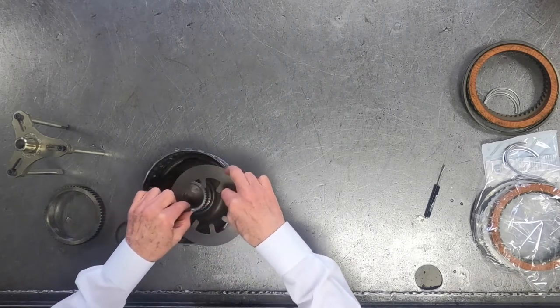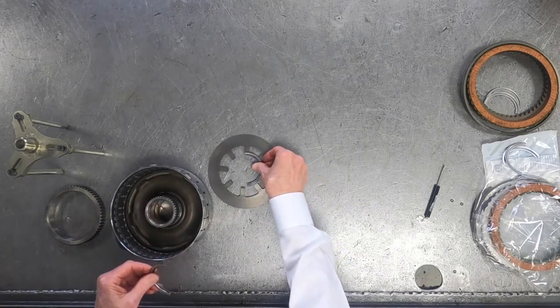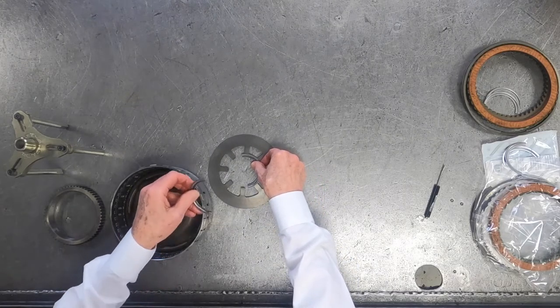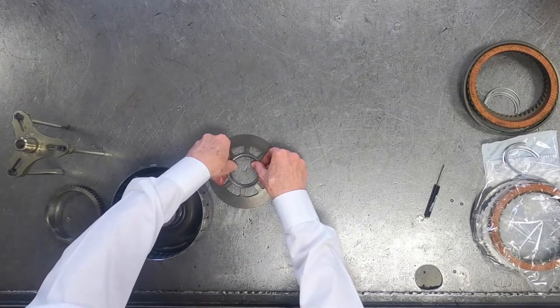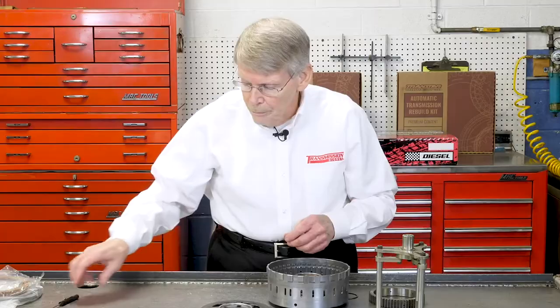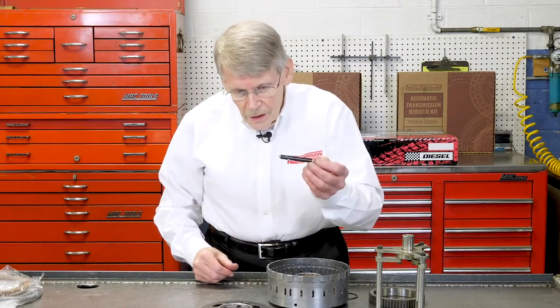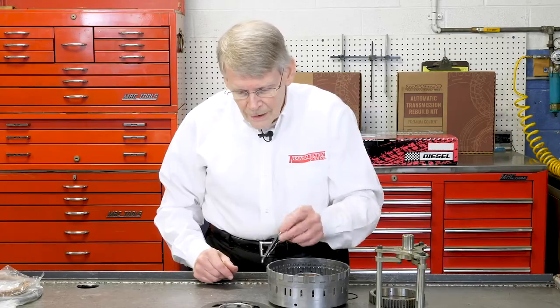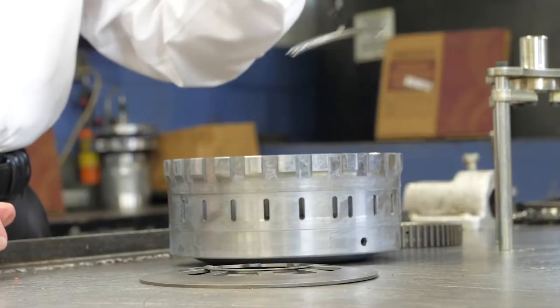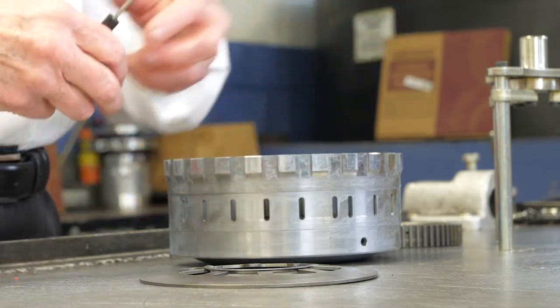The Belleville fingers can actually damage these over time, to where you have to replace them, or even sometimes trying to get them out you could end up bending them. As a point of interest, I always just take a little magnet and pop them out and then pop them back in — it's easier than trying to use your fingers.